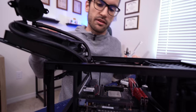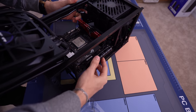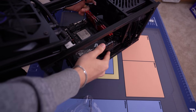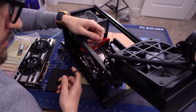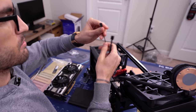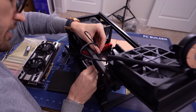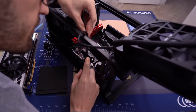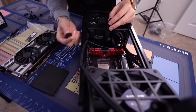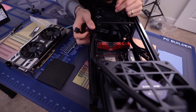The easy stuff is really all that's left, and that's kind of refreshing. So we're going to go ahead and connect the PCIe riser — it's already got a 180-degree bend to it, and it just clips in like so. That's a very clean look. The fan is a PWM fan, so four pins here, three pins for the pump. I'm going to plug in both of those. Now, USB Type-C — this motherboard doesn't have Type-C support, so we're not going to have support for that on this build. It's not a huge deal, but just know that the case has support for it.